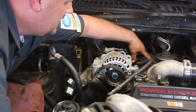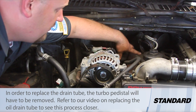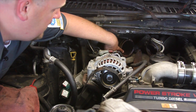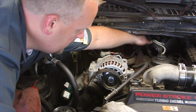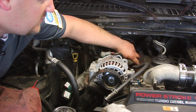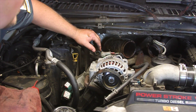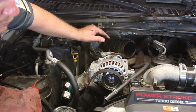We need to make sure this drain tube is not rusted out — let's replace that. We're going to reinstall with a new o-ring and lubricate it. We want to make sure all of our flanges are good and tight, not bent. You can now see where the three bolt holes are: one comes off the backside which is pretty difficult to access, one was underneath the turbo, and one on the front side. Let's do a little more work on that drain tube and then we're ready to install our new turbo.